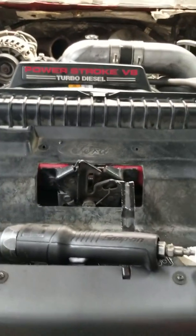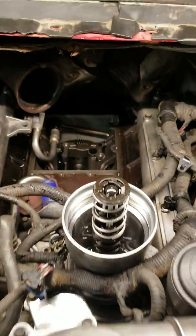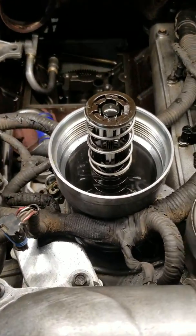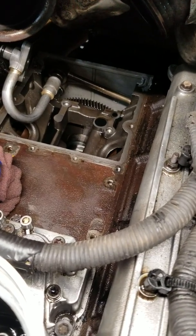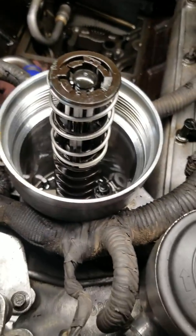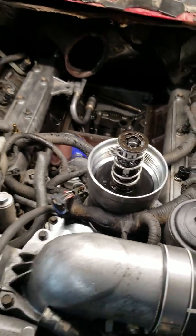We're working on a Power Stroke 2004 F-250 and it has the round type oil pump. I brought a brand new one from Ford and we're still hearing gurgling up through the tube. We're doing a test through the ICP, through the rails, over to the branch tube — that tube that's actually up right now — and it goes into the oil pump, which then in turn goes to that chamber up to the cooler, and that's why we're hearing a gurgling.